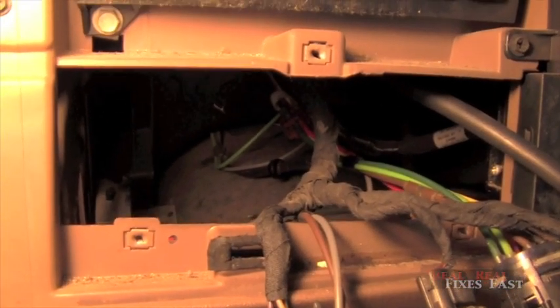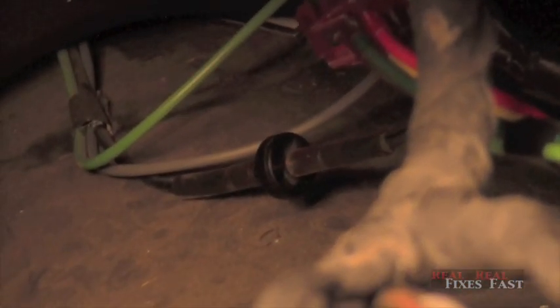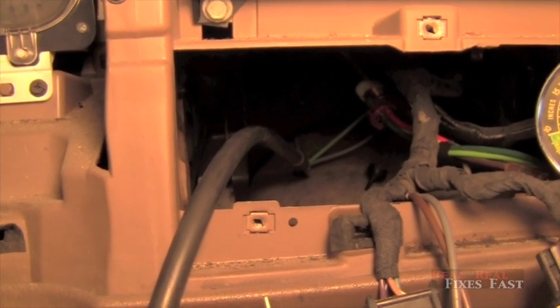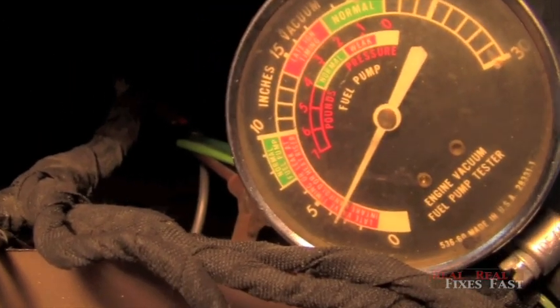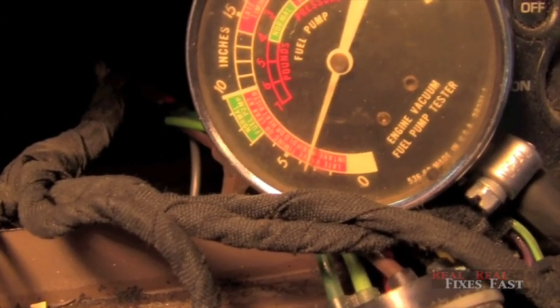The first thing I want to know on this one is whether or not I have vacuum. I'm going to pull that check valve out and see if I have vacuum on the input side of it. If you look down inside there, you can see my check valve is hanging loose over here to the side. Taking that out of that line, I have my vacuum gauge now plugged into that line. I'm going to start the vehicle and see what our vacuum looks like. We're reading zero vacuum — going to start the truck. As you can see, I'm only reading about three and a half, four pounds vacuum. That's not enough to operate this controller.